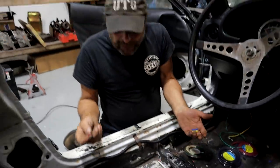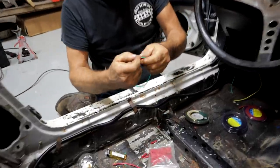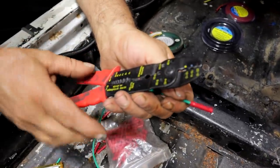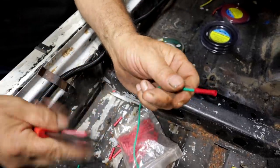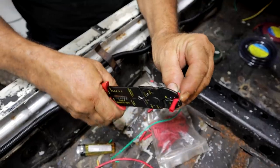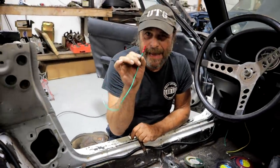There's no mystery as to how these work. You take your wire and slip it in, then take your crimper. These universal crimping tools are great, but it's important you have a good one because the cheap ones move all over the place as you squeeze and don't work. You crimp it — boom — and I always give it a second crimp. Not quite done though. These were never intended to be used exactly like that.